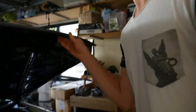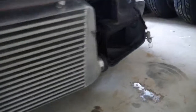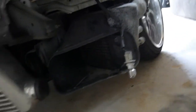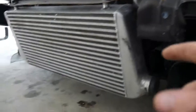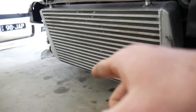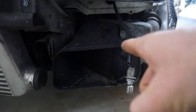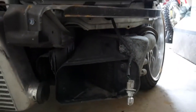Alright, the first thing we've got to do is take the front bumper off. I've just got to pop the bonnet so I can take my cooling panel off and undo it from the top, and then after it's undone from the top I'm going to do it from the wheel wells. Before you guys say anything, the front mount intercooler is not connected — it's still running the side mount intercooler. This is because when I bought the car they had it set up as a return flow with a 180-degree silicone hose to a straight pipe piped up to the stock intercooler piping.